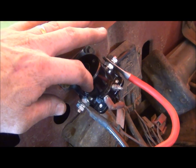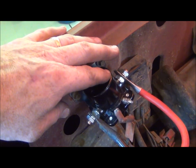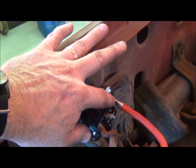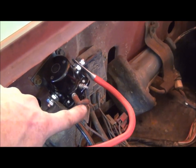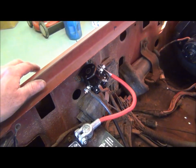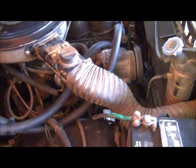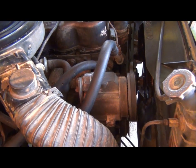The S terminal is the switch solenoid — inside this solenoid you have a switched mechanism or coil that creates a magnetic field. What that does is cause a washer-type device to come down and connect both terminals, so current comes from the battery, crosses through the switch, and leads down to the starter wire, which is what cranks the starter. It sounds a little complicated but it's not too bad once you understand the basic concepts. Anyway, get the water pump on, everything installed, fired up — we're good to go. Thanks for watching and stay tuned.